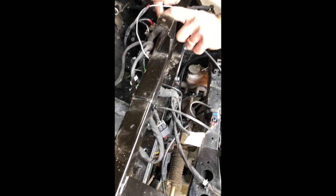Here's where the control box goes — it's mounted right above the power steering motor. Once mounted, it was a little confusing. The bolt that mounts it needs to go in the opposite direction from what the instructions show, otherwise the bolt hits where the plug is. I turned it around and it's mounted up here.